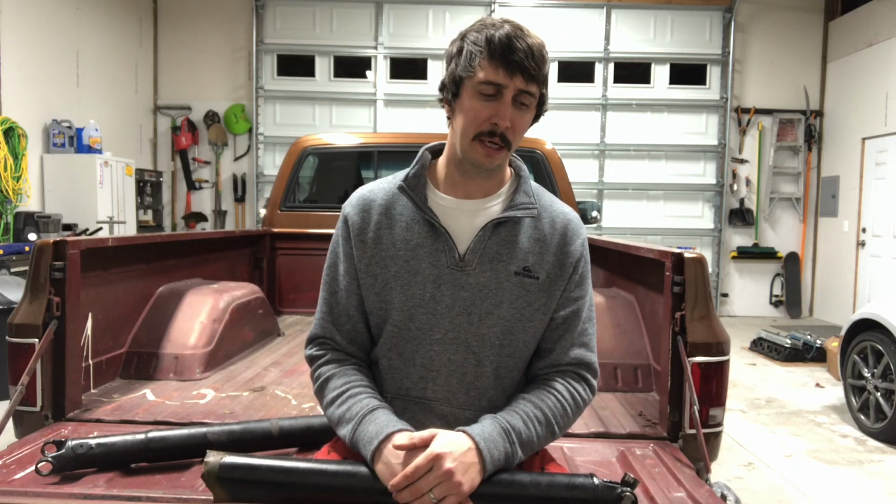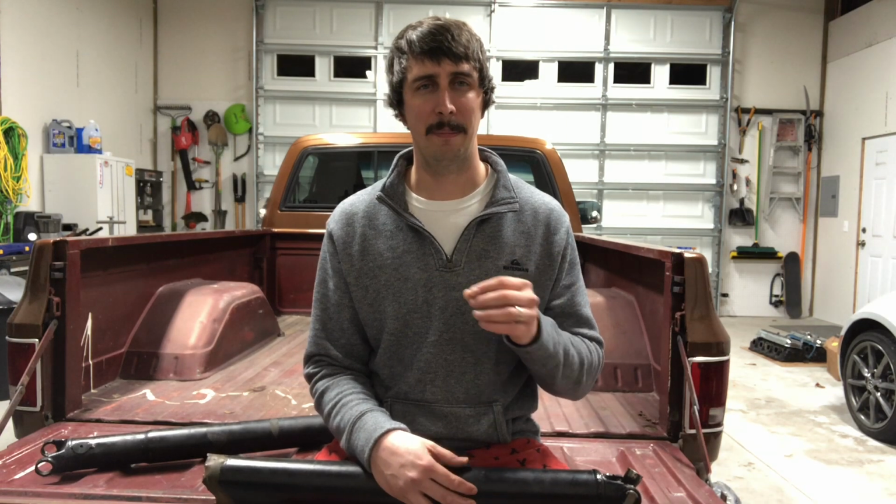As you know, I've got the 3-inch exhaust. The headers are 1 3/4 inch, so potentially you could maybe pick up if you went to a 1 7/8 or a 2-inch primary. But either way, I think all in all, anytime you can pick up roughly 110 wheel horsepower with bolt-on upgrades, that's a total win. The other big thing to look at here is the area under the curve.